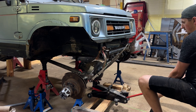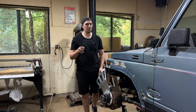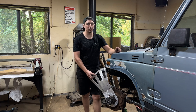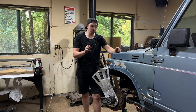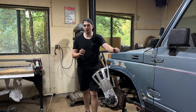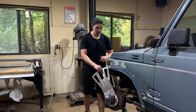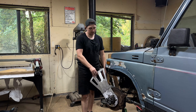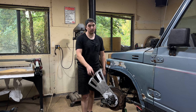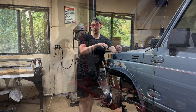This tire fitment tool gauge that I made has been working really well. Unfortunately, maybe too well, because it is highlighting a lot of issues — my current setup is not going to work for the tires that I'm looking for. I've been really optimistic about this 100-inch wheelbase and hoping I could squeeze in 37 or 38-inch tires, but cycling this axle up and down through all the different configurations, I'm realizing these tires just won't fit. So I've got one last hope: I'm going to try to raise the actual Samurai up three inches.